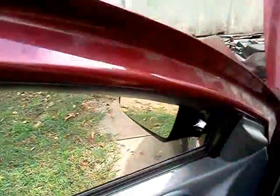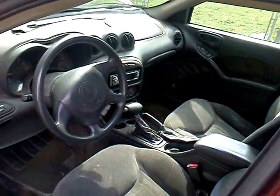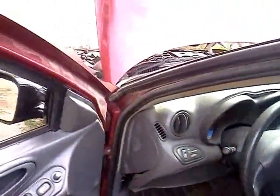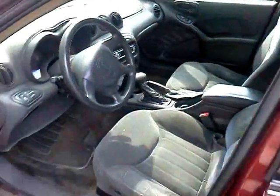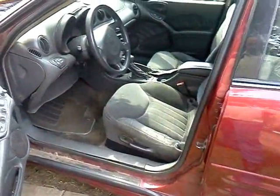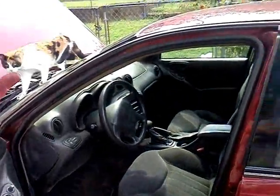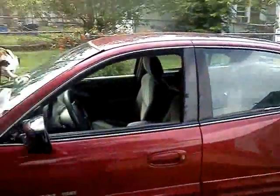That right there, that can be fixed. Missing a couple of knobs. Aftermarket JVC stereo. Cruise control — looks like one of the buttons is out. Looks like they never tried to protect the inside because you can see everything's coming up. But all in all, she's a good car. Hopefully it's just going to be the head gasket and all we'll have to do is replace those — we won't have to resurface the head or the top of the block. So, $400, baby. We'll see what we got. We'll be seeing ya.